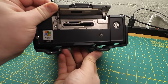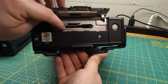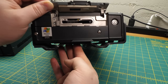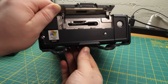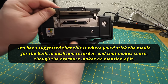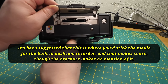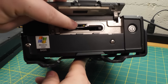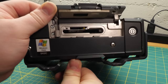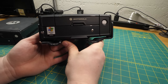Most of what makes this interesting is on the inside, but first let's finish the tour of the outside. On the front, all we have is this flap which exposes what I thought was an Express card slot — we're talking 2009 to 2010 here — but it turns out that's actually Cardbus. My guess is it's something to do with either putting a CF card in there, or some specialty hardware only produced in a Cardbus variant. There were bridge machines in this era that had both Cardbus and Express card, so there must have been legacy hardware that didn't get updated. Above that we've got a SIM card slot, which has what appears to be an ejection button next to it — I've never actually seen that before. Usually you just pick it out with your fingernails. And then there's the power button — since this is in the trunk, you'll never need to press it; it gets turned on remotely.